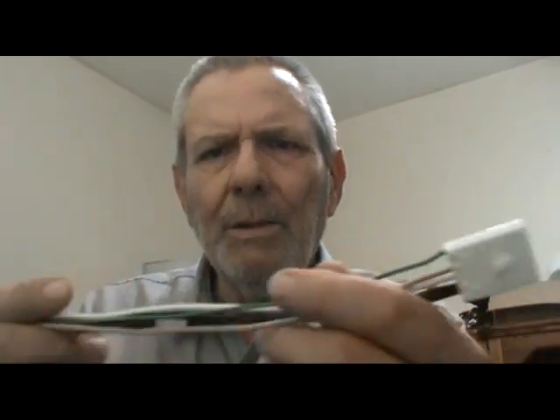I figured — the customer's other refrigerator is being taken out, and they have a modular ice maker in it if it's a Whirlpool. Even other brands have the modular ice maker — all the Whirlpool brands: Amana, KitchenAid, Roper, all of them. Even most of the Sub-Zeros use them. So I figured, forget about their new ice maker because it's still a troublesome design — I don't know why they went back to it. I'll make this new harness. Whirlpool will never make it. This five-pin harness — the five-pin connector plugs into the new connector in the back wall in the freezer, and then this plugs into the modular ice maker.